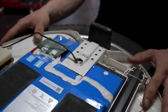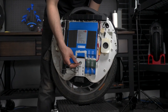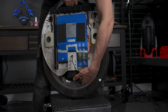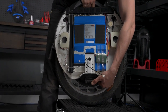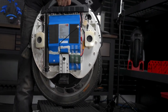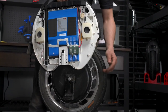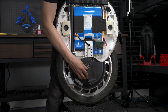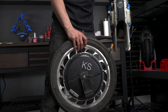Now let's turn the wheel right side up and remove the motor. Be sure when pulling the case off that you don't rip any of your wires on the case — go very slow. You can also wedge the case apart from the pedal hanger to not pinch the wire as you slide it off. Pull this wire out and be sure you're keeping an eye on the other side for the motor wire as well — you'll need to slide that out just the same. Now set the case to the side.